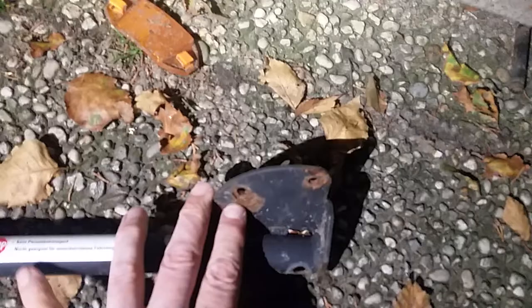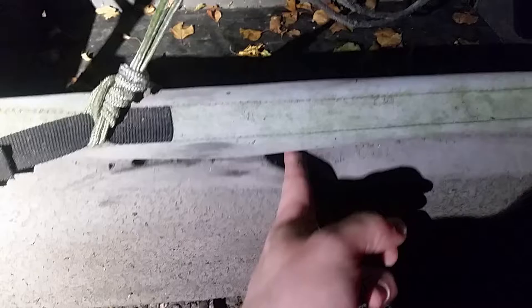Okay, to the trailer. I've been using this quite a lot — for renovations, to transport stuff, to recycling stones, a leaking radiator, etc. I loaded it quite a bit. I've told you about the problems I had with this trailer. I drilled an extra hole into this plate to make it more sturdy because it broke one time. And you can see how much it has deformed. The second bolt just didn't help in that respect. A flat plate will bend — this is just a bad design. The whole thing is not very good.